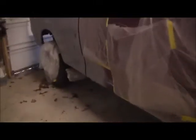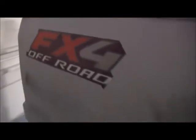So by applying that guide coat, once you start doing your wet sanding, you'll be able to see the actual imperfections in the paint. So once you have all of that guide coat sanded down with your 320 and then 400, that primer should be smooth as glass and have a nice reflection on it. Sticker. And once this is all wet sanded, all the edges are done, I'll retape it. When we paint it, it'll be masked off, and then I'll remove the tape and then clear over it with the whole side of the bed. All right, let's get to it.